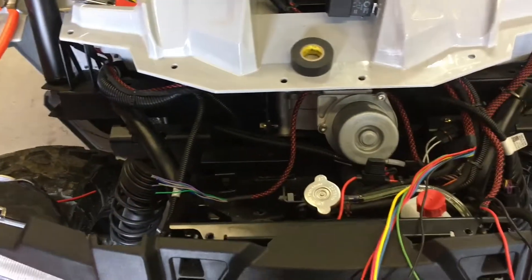The factory headlight harness on this vehicle runs on a ground circuit. With the key on, the relay kicks in the fuse box and sends power to the headlights, but the key switch actually provides ground to the lights to turn them on. So I required a relay up here to convert that ground signal to a positive signal for the high beams. The headlights are still fused through the factory fuse block.